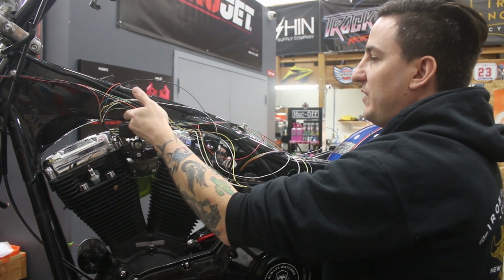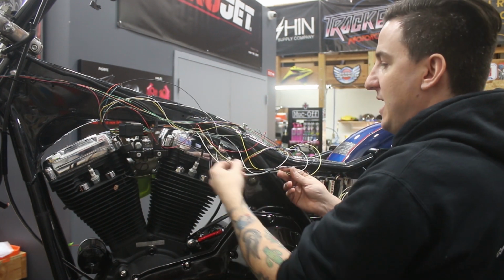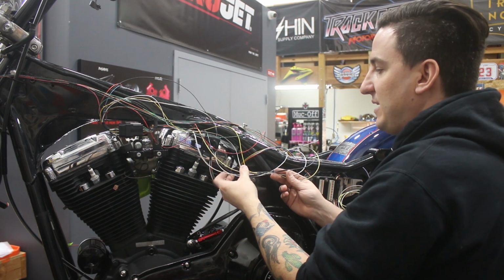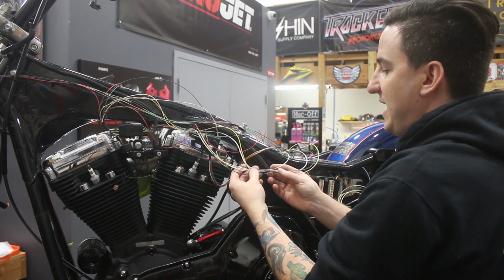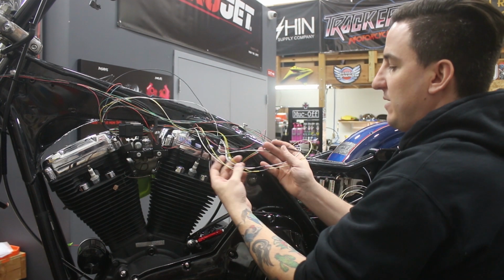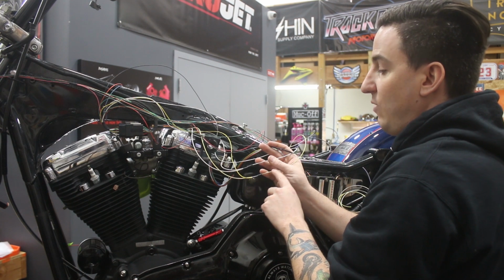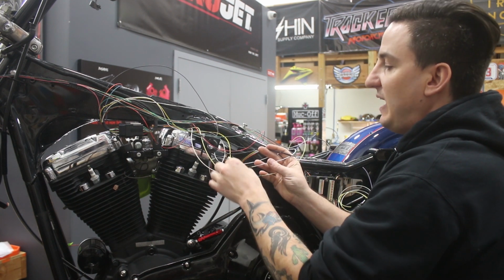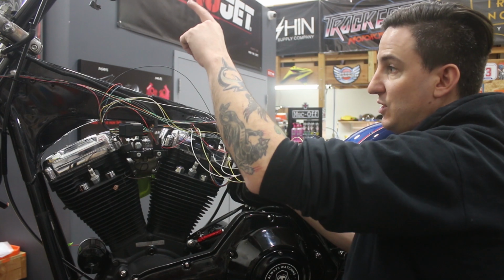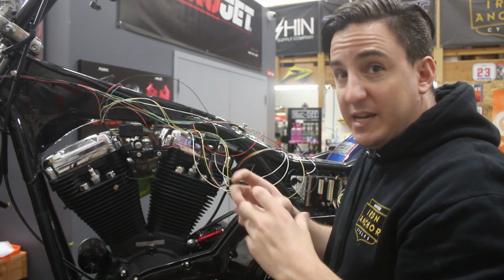Now, once you have the bike side of the harnesses in place and you know how the wires are going to run, you can tap one into the other, and that's what we've done. The two smaller wires are tapped. I'm sorry, there's a little bit of a mess here. The two smaller wires are tapped into the two bigger wires, so that when we activate the turn signals, you have a takeoff coming from each of these that's going up to your indicators on the dash.